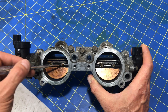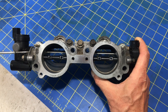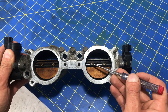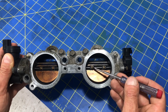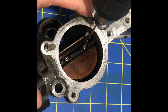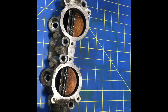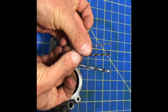The easiest thing I've found to do is go ahead and drill out these little screws so the blades can slide out easily. Here's my other TGV — those screw holes stripped as soon as I tried the Phillips screwdriver, so I had to drill them out. For this TGV I'll show you how to modify it: first I'll use a small drill bit to do a pilot hole through the screw, then step up to a larger diameter bit, and finally to the final diameter. I like to do it in three steps. These are basically the three drill bit sizes I'm using.